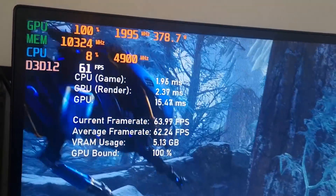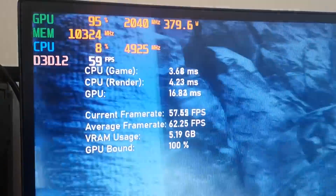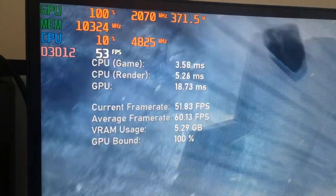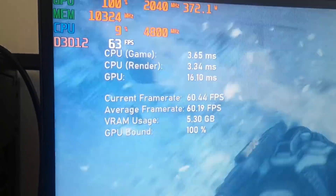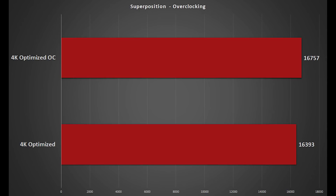This would, of course, depend on whether the ray tracing units were active and so on. The power limit slider for our Founders Edition card would allow us to boost by 14%, giving some additional leeway with frequency. With my additional tweaking, we're now pushing around 380 watts into the card, and in Gears of War 5 the clock frequency was boosting to 2000MHz to 2050MHz, which is not too shabby. You can see benchmark results here to give you an idea of the performance — long story short, it's a couple of frames per second faster. I suspect that pushing more power into the card could certainly achieve higher clock frequencies.